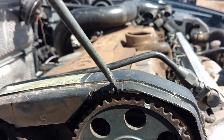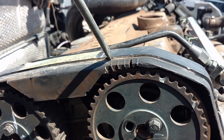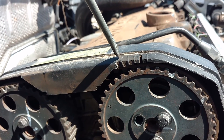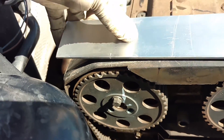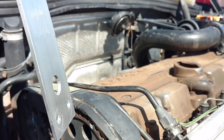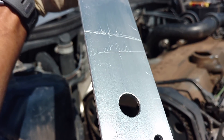Clockwise is advance, and you'll see that tool move. The sprocket and timing belt stay the same, so if you change your belt none of that changes. But this will make the cam advance or retard — it has a slot in there so you can adjust the timing a little bit. The cover has markings: 0, 10, 20, 30 — but these are not 10 degrees each. Ten is 5 degrees, 20 is 10 degrees, 30 is 15 degrees. So each notch is actually 5 degrees. I have my little homemade tool — I line it up at 0, put a mark over the exhaust cam, 0 is my intake cam mark, then I pull the top two screws out, snug it against there, and the lower marks are for the intake cam while the upper marks are for the exhaust cam — so I can retard or advance, each notch being one degree.